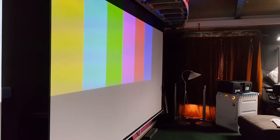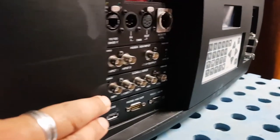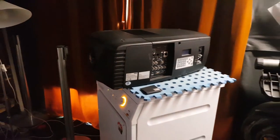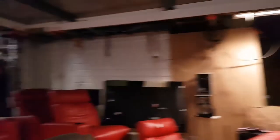I'm not sure what this video is going to be about — it might just be me getting some test patterns, trying to fit my screen, and trying to use the lens shift to get a good image. I've worked out I might need a DVI card — these projectors take different types of cards for inputs. In the manual it says the longest throw distance was 6.6 meters; I'm pretty sure we're at about 7.1 meters, so let's see if we can focus it.